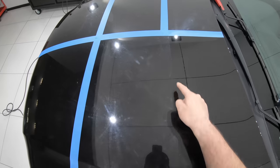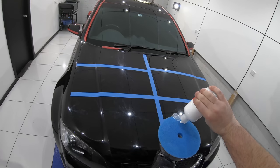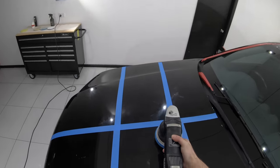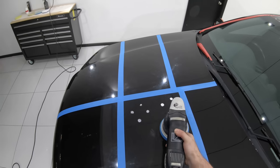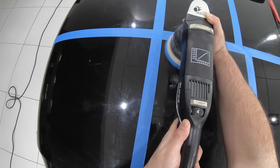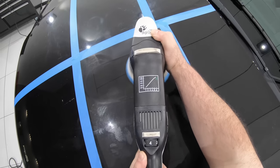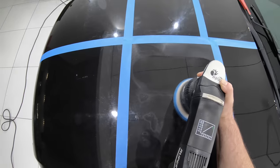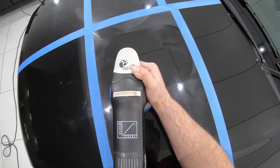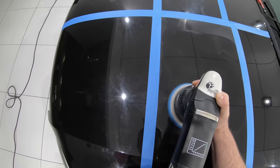But in understanding all of that, you can certainly still achieve as good a result and potentially even better by working quite differently, as long as you understand and know how to adapt that different technique successfully. So let me give you an example. Taking that basic paint correction technique I just described, keeping everything the same except for changing only two things. Firstly, doing 8 row passes instead of 4, and secondly, doubling your arm speed movement will, based on my own testing, render pretty much identical results.